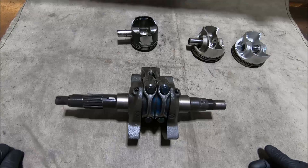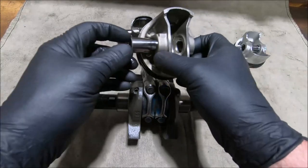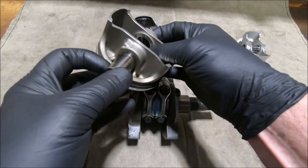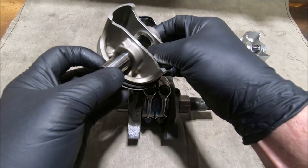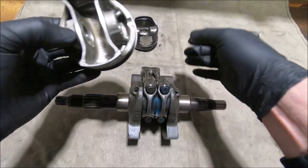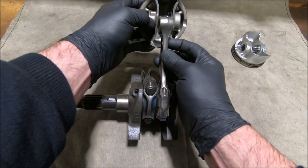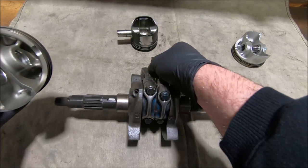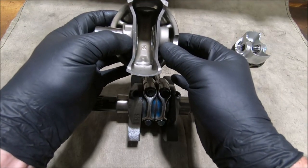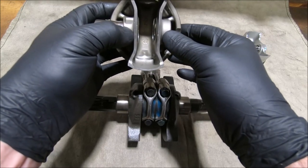When they went to small end located rods — this is a 749 piston, which is a small end located piston — you can see the piston is machined on this surface here. When the piston goes on the rod it won't fit on this rod because it's too wide. There's about 0.3mm side movement between the piston and the rod, so the piston is located in the cylinder and the rod is located in the piston groove.